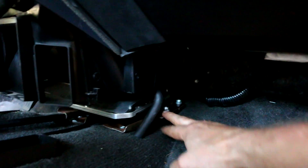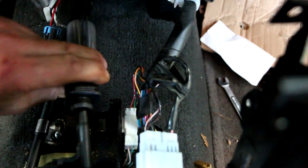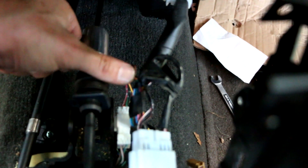I'm in the home stretch. I got the pan back in and mounted the electrical doohickey — just a reminder, make sure you reattach that HVAC hose; it just slips on with no clamp. Now the eye on the end of the new cable needs to be popped over the pin, then snap the restraint back into position. It's easier to get the cable on first, then snap the clip down. When snapping the clip, make sure the side with the ribs is facing up — then it just clicks right in.